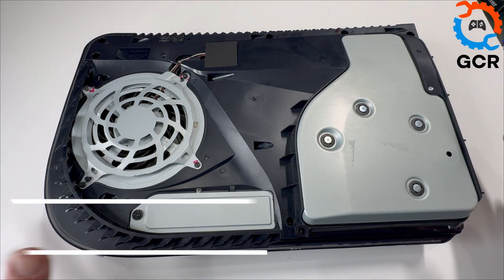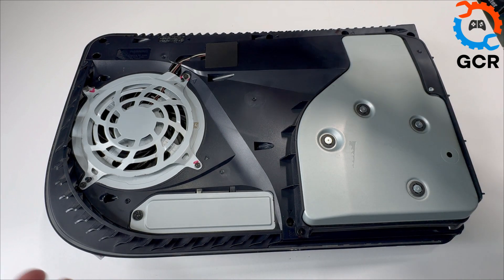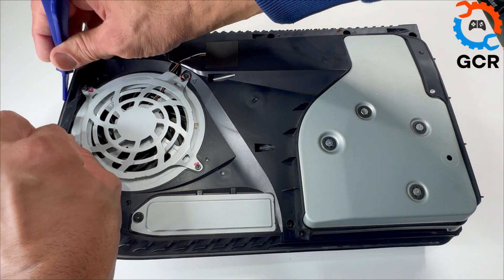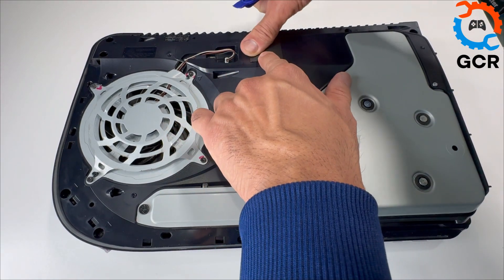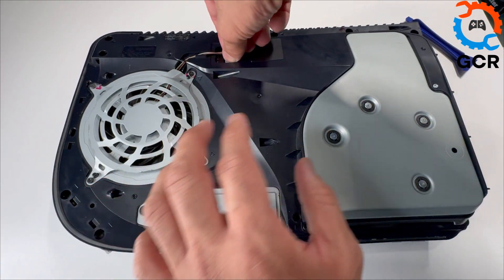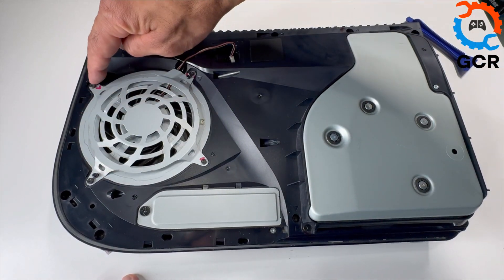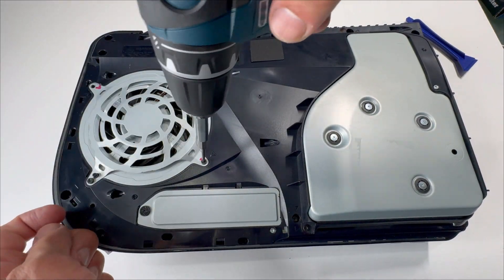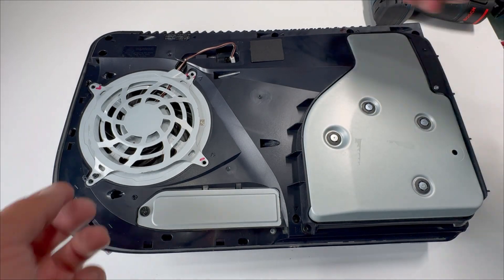You can watch our other videos on how to remove the side panels — I've already done that on this one. Let's carry on with the remaining disassembly. Grab your plastic pry opening tool, open up the side grill, take out the adhesive pad, and disconnect the fan power connector. Remove the fan — there are four screws: one long, two medium, and one small. Lift it up.